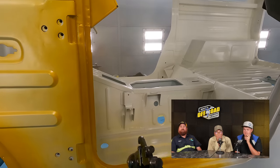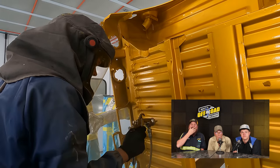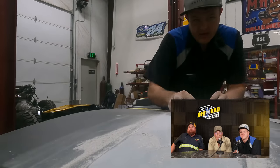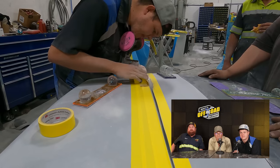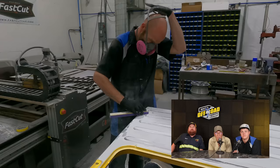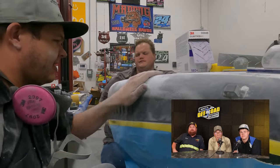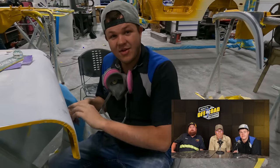That's better than new — all that coating and painting. You want to let the block and your sandpaper do the work. It's about got a racing stripe. This is how you get lines straight. These are little minor imperfections that you don't necessarily feel until you start blocking. It's getting there. It's totally worth it. This back door is ready for polyester primer — just got to get all these edges sanded by hand. And the hood is ready to prime.